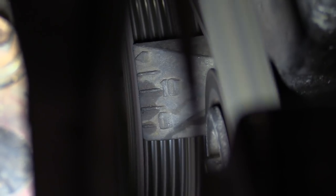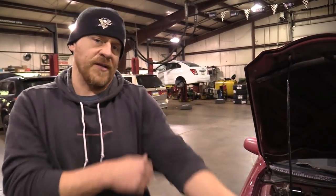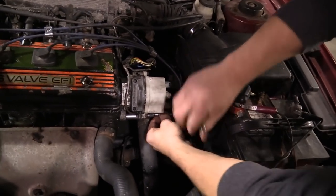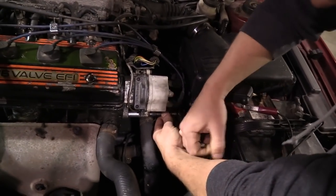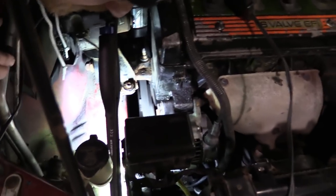I'm okay with being one degree too high — that's pretty much it. Now I need to snug this down and then recheck to make sure the mark didn't move. I have the lower one still loose, so we'll have to adjust that, but this will be the one holding it. We check it again — just a smidge above 10 degrees. I'm good with that.